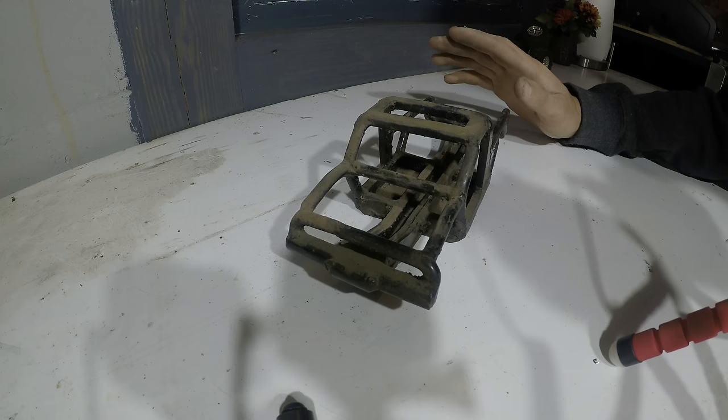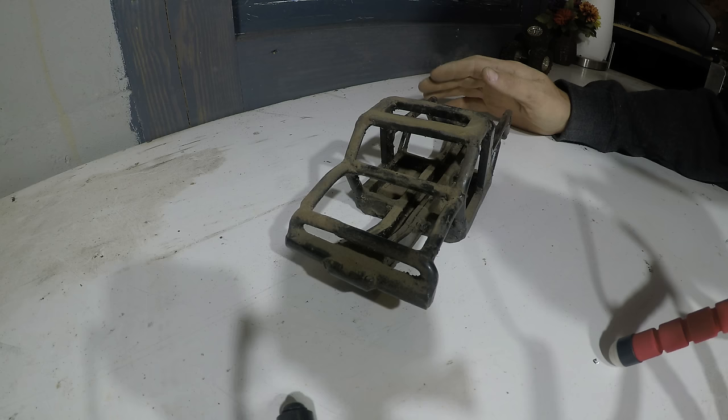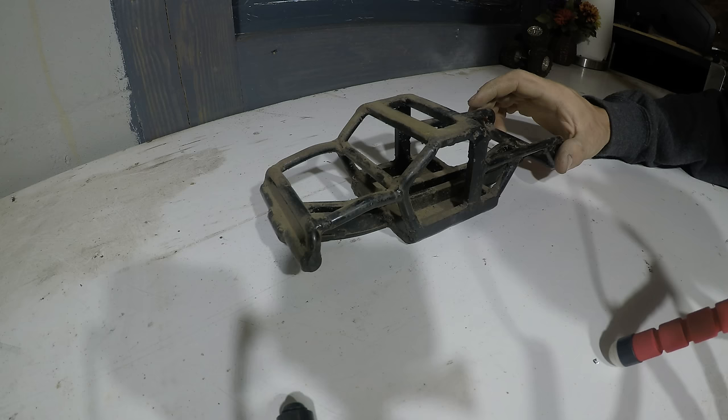The other thing that's great about them is they can run the other direction, so you don't need a reverse gear. You can just have the electric motor hooked right to the wheels, and it can run backwards as well. And they can do the braking, and when braking, they take that energy and store it. So if you built the entire truck electric, you almost wouldn't need brakes on it, because 99% of the time you could just use the electric motors to do all the braking.